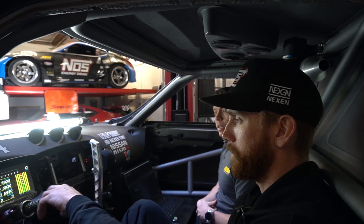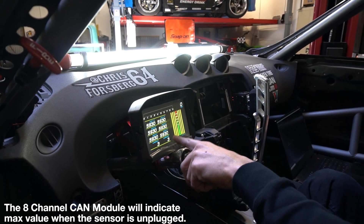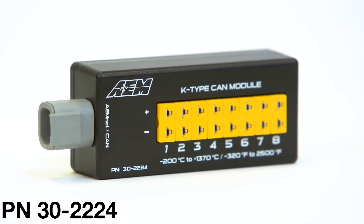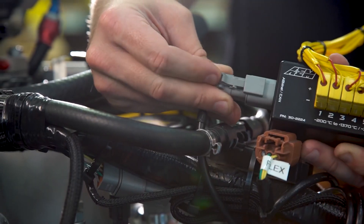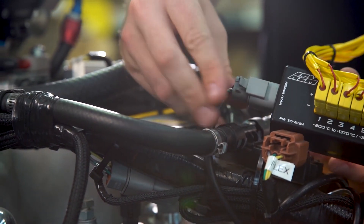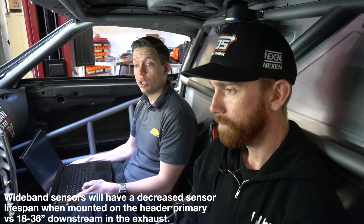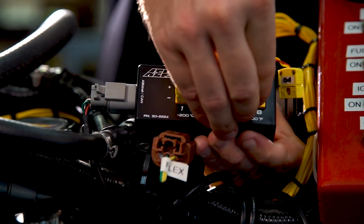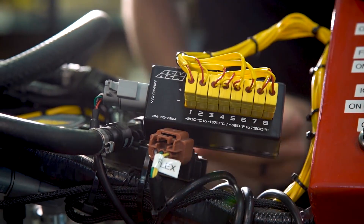This screen is pretty awesome. We've got each EGT on each cylinder and we have the lambda collecting on both collectors. The K-type EGT sensors are a very robust sensor — they'll last a very long time in the collector, so you don't need to worry about changing them out constantly. A wideband sensor is great for some initial tuning, but for longevity, you probably don't want to leave the sensor in there full time.